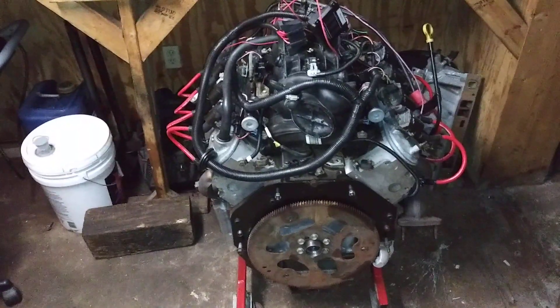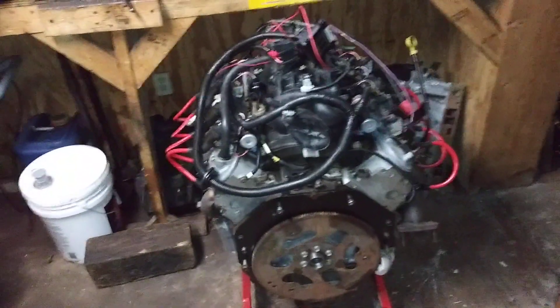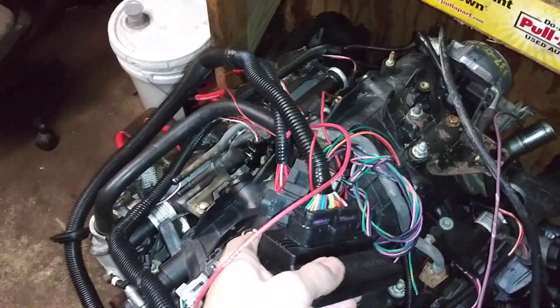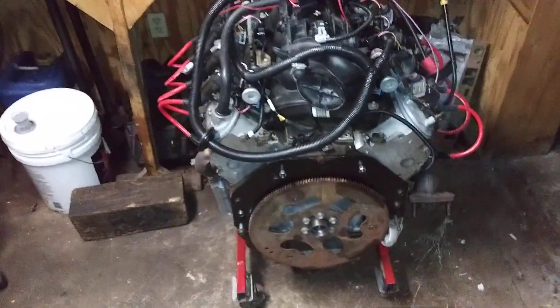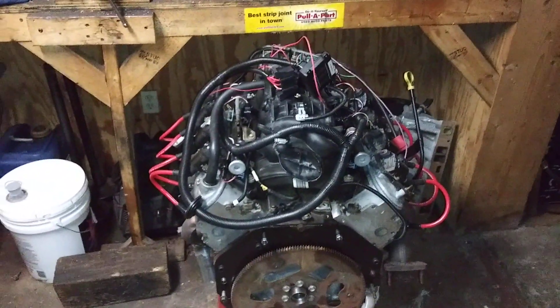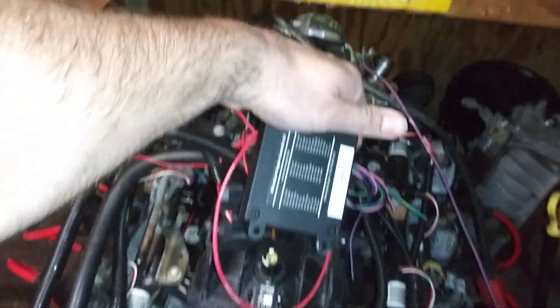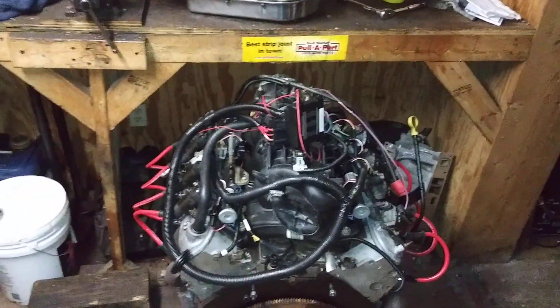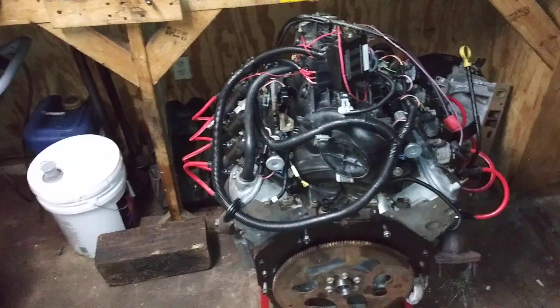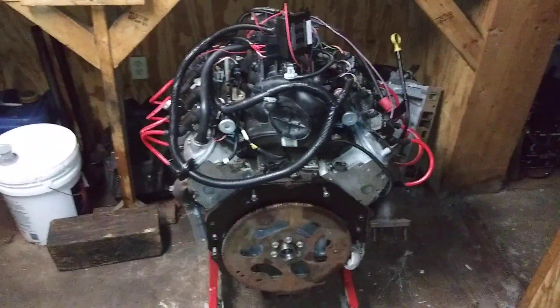Anyway, I felt I needed to make a correction. DIY Auto Tune does sell micro squirt but it is not plug-and-play. Six hundred ninety-five bucks. If you're really cheap and really want to do the work yourself, you get the little controller and three to five feet of wire — that kit is like $300, $350, or $395 — and you just do it yourself, but you have to do all the fancy wiring. This one is specifically set up for the LS engine so it's plug-and-play. The 24x modification basically means they just added a couple resistors in there to assist with the spark setup, the coil pack setup.